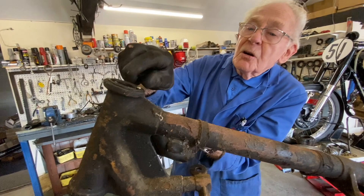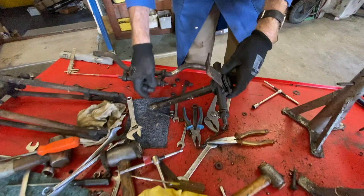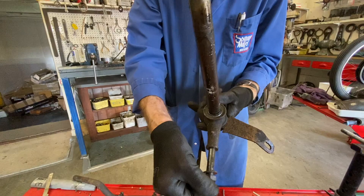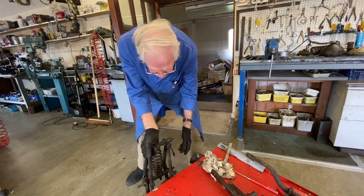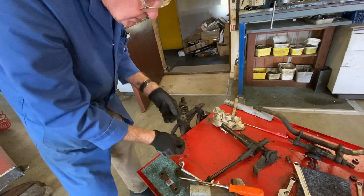Right, that's the fork side — we'll have a look at that. That's the bottom damper here — that'll all need taken apart and checked out. Again a friction damper — the reason why that won't come out is you've got to drop that spindle out like that. That's there, but that drops out like that, so that's the bottom of your fork. More dampers here — fair bit of cleaning up to do. These are your shims that go on the side here — we've taken note of where they go and they'll go back together.